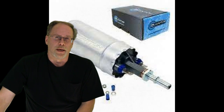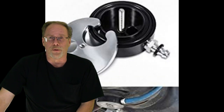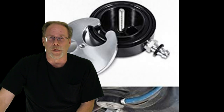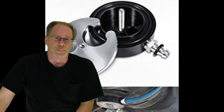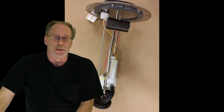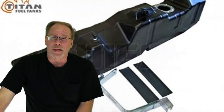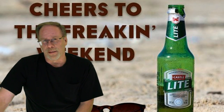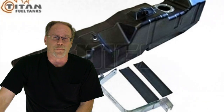The sump setup is really going to save the fuel pump — it's not going to heat up as much, it's not going to have to suck as hard through the straw system. Gravity is now with the sump, taking over and forcing the fuel. You also never need to worry about cleaning those pesky little filters in the draw straw pickup, which involves dropping the tank. This right here is a real time-saver for that.